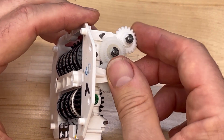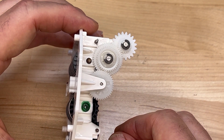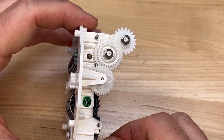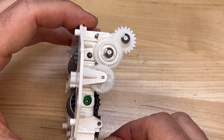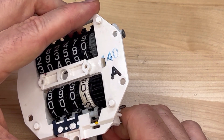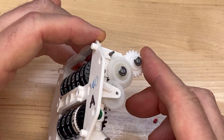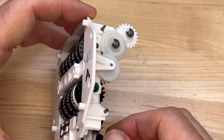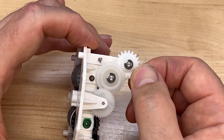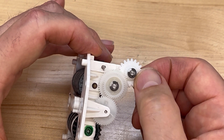I think the reality is these gears — in particular the ones from the factory that were made in that amber color, kind of translucent amber color — that material just doesn't last. If the gear breaks because the black gear and the white gear are being recoupled, then the gear was going to break anyway. Even a pothole would have done it. And that's everyone's experience. When you take these things apart, 10 times out of 10, they crumble.